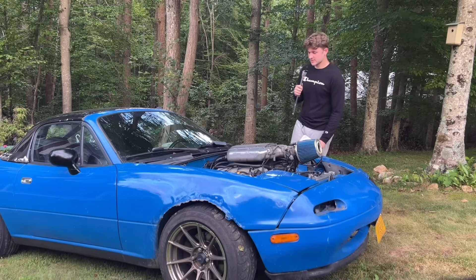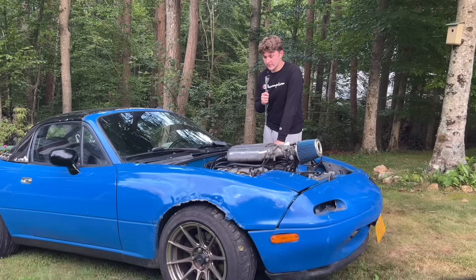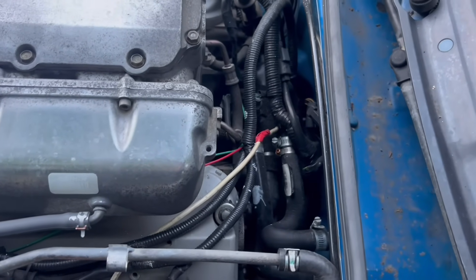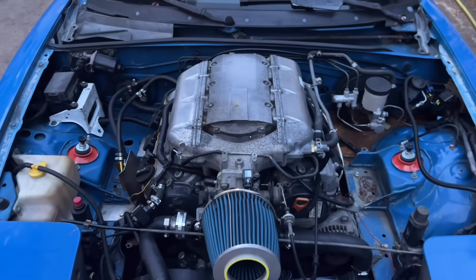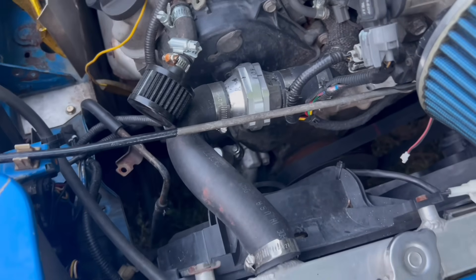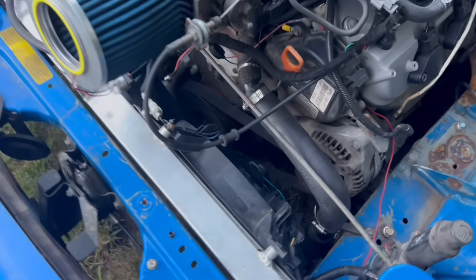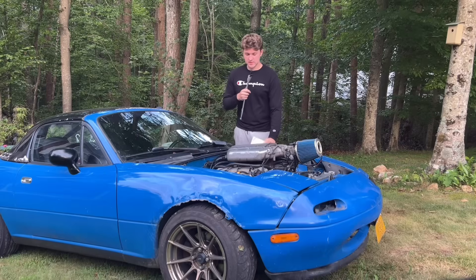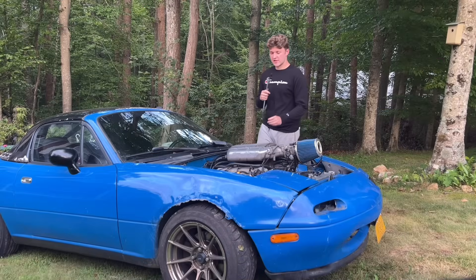Fortunately, part of the kit included Oz Engineering's coolant manifold reroute — and this is ironically the first time I've done a coolant reroute on a Miata. I've owned like 30. But this is great because there is a ton of space in the back of the motor for your heater core hoses and activities in general. The coolant manifold comes right through to the front where there is an inline Mazda thermostat, and it routes right to the original stock Miata radiator. I have a cheap eBay aluminum radiator on this — just a good upgrade to do in general. I also swapped the valve covers just to shorten some length and make it a little easier for the vacuum routing for the brake booster line — spliced it together, made my own little doohickey.